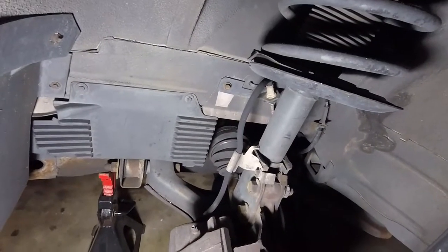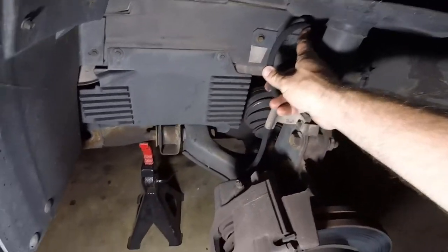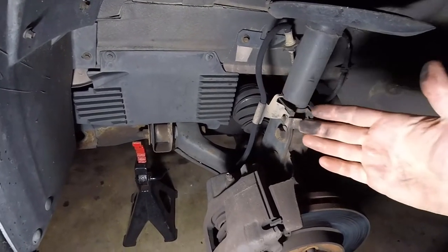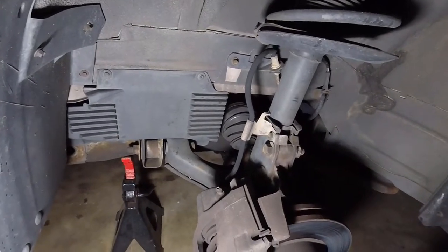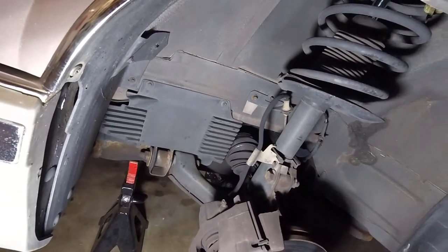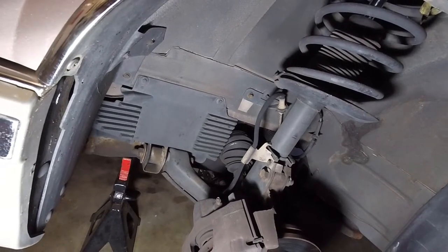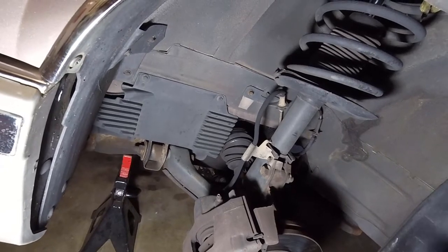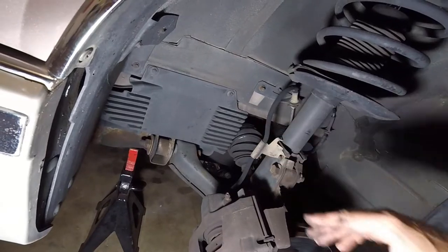While we're here, inspect everything, right? So here's your soft brake line. You can see the sheathing here is a little worn and broken. Now, the brakes still work, obviously, but the sheathing and these brake lines are from 1991. So to be honest with you, I'm probably going to go online and source some brake hoses. And when I do the rear brakes, I am going to bite the bullet, redo everything, and bleed the brakes, because peace of mind. This is my daily driver.